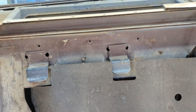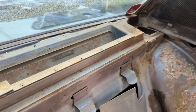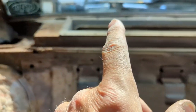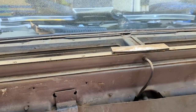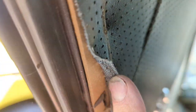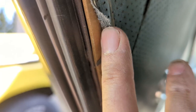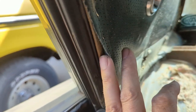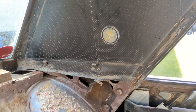It's a good opportunity to clean the rear vent and everything while you're in there. I did take the rear vent trim off on the outside to check the whole vent, but it's not necessary for the roof liner. There are a million staples and they all have to come out. Below the staples are the tack strips — available at Bird Nest for about $89 a set. These look to be in pretty decent shape, so I may offset the staples and reuse them.